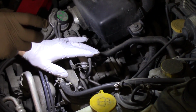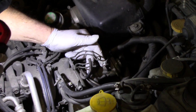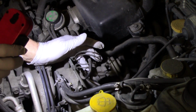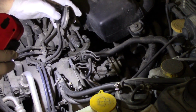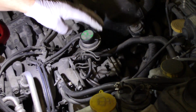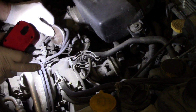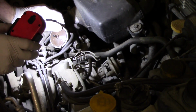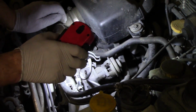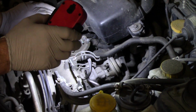Look down inside of this steel tube here. This is the number one cause for this code. This steel tube becomes restricted with a buildup of carbon and doesn't allow enough exhaust back pressure to reach the transducer. When you pull it off, look for moisture in the transducer. That's another sign that it's restricted, but sometimes these can just be clogged up with moisture and cause that issue. So make sure your transducer port looks clear, and then we're going to pull off this tube here, because I can see down in there it's restricted. Hopefully you can get a better look.